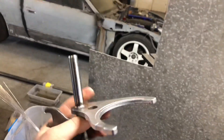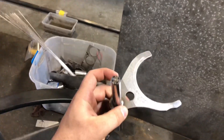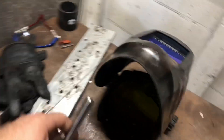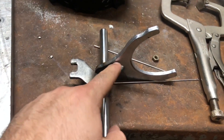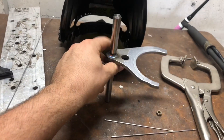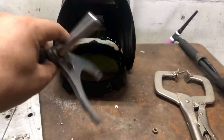The problem with this right here — this is the selector fork for first and second gear within the b-series all-wheel drive transmission that comes out of the CRV. Basically, this part that goes around the selector fork itself bends. So essentially what the reinforcement method is, is to weld on some gussets to give a little more structural strength to the fork itself, so that when we're shifting fast or under load we're not going to be stressing or bending this fork as much.